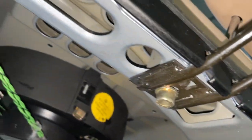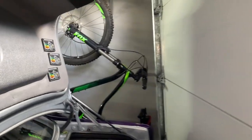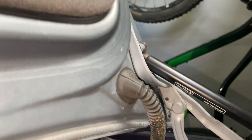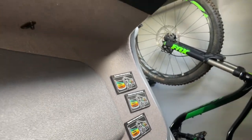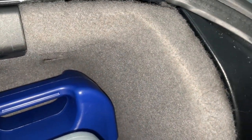We're going to go up above in the trunk. You can see there's some holes there. And we're going to stretch all the way across to the very other side of the car, in which case we're going to pull the wires out from over there. Then we can meet ourselves at the trunk. We can wire up from over here through this little cabling harness that goes to the trunk lid itself, which is where we'll access our camera. And then we can get power from our reverse taillight on this side of the car.